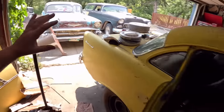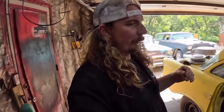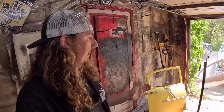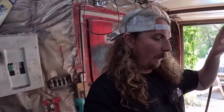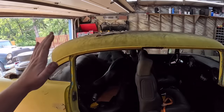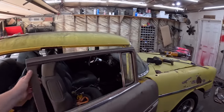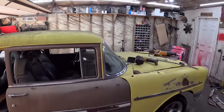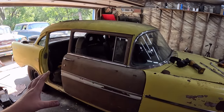But as we cut and fit it, what I typically will do is we're going to just blindly cut it, get some of the junk off. I'll actually latch the door to it and we'll close everything. We'll weld the post in, then we'll just kind of push it back and get everything kind of tacked into place, and you'll have to trust me, but it'll start looking like a Tri-5 Chevy two-door, like, in a frickin' hurry. Frankenstein, but in a hurry.